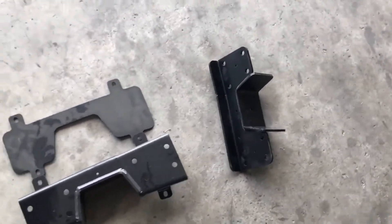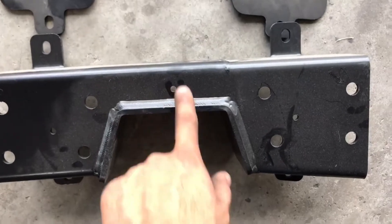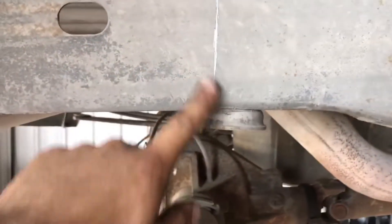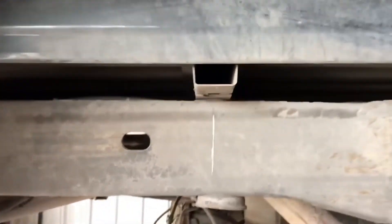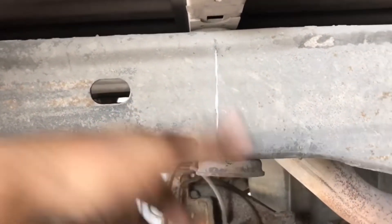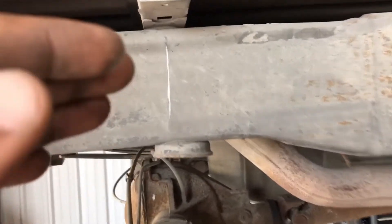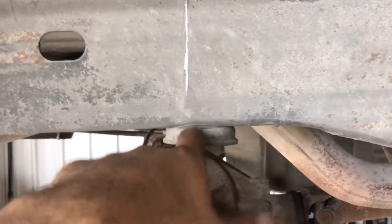This is the middle of the frame. Everybody thinks this is the middle where everything is - no. You go off your bed row. Use the bed row - the middle of the bed row - and mark the line down. Just scratch the frame or however you want it. That's where the axle hits. On a differential it doesn't hit right here for some reason, it's over here - this ain't the middle.